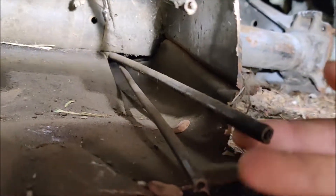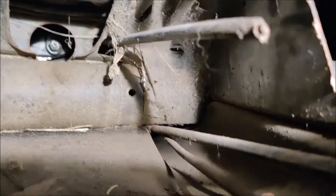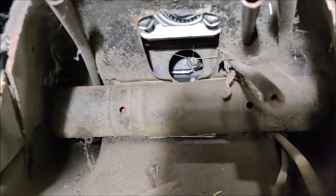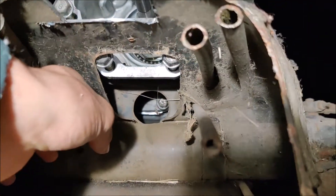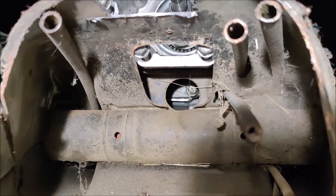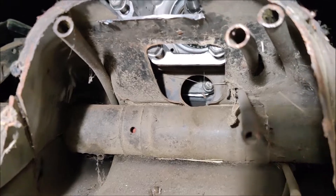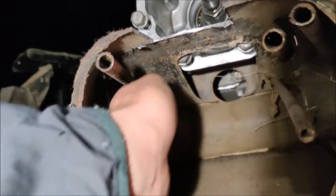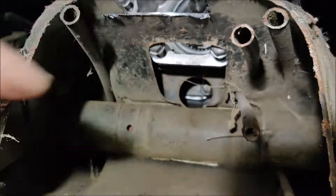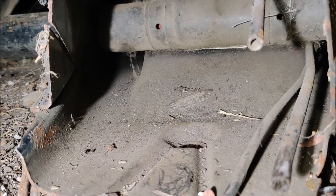We're going to have to work around the cabling, fuel lines, parking brake lines and all that stuff - but those are flex cables anyway. All in all I think this isn't going to be too bad. The trickiest part is going to be trying to replace the center stuff. We could weld it from the underside - we don't need that ramp down if we can cut that thing out, cut the bottom out, cut the top out, and put a thicker wall there. We'll have to do something thicker coming across the top to tie it all together, maybe an HSS tube or 3/8 plate - something good and sturdy.